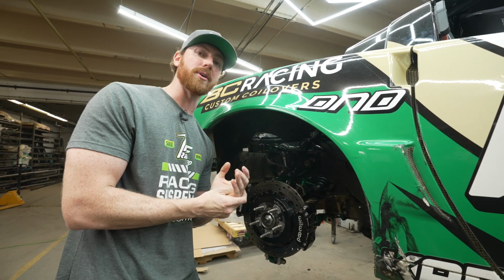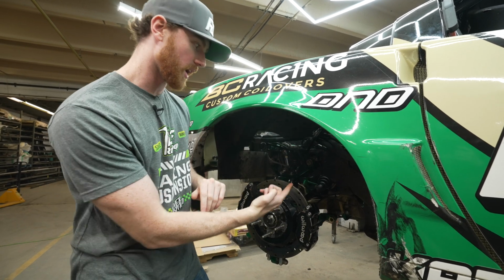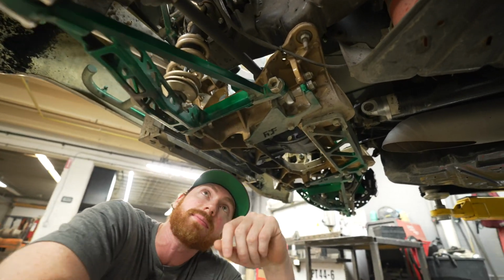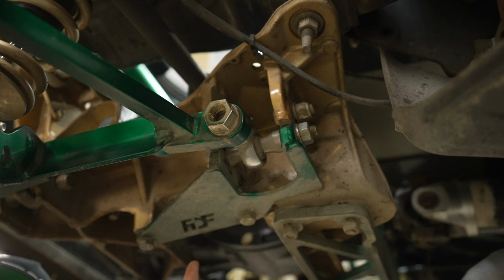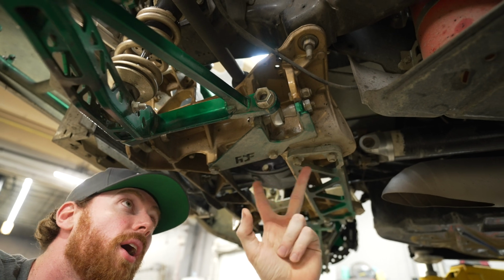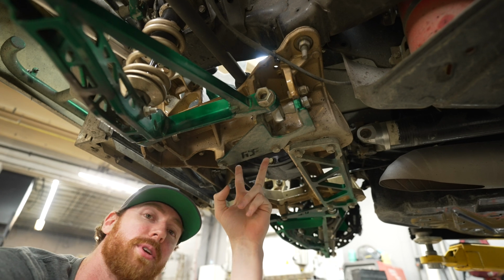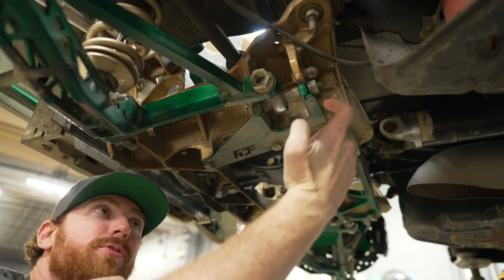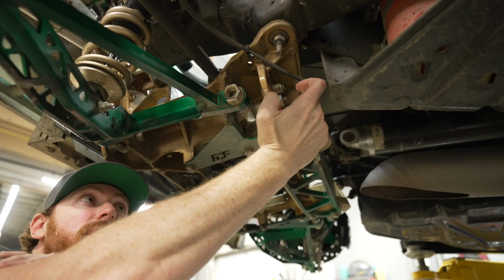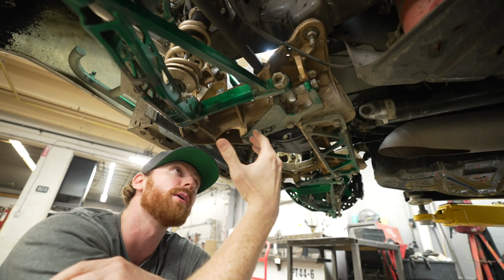So we gave you the ability to adjust anti-squat from the factory location, and then 3 more points below that. You can see that right in here on the subframe. Jack, can you see it? Here? Can you see? Yeah. Okay, Jack. Okay, guys, this is the anti-squat adjustment bracket. This bracket bolts to 2 bolts on the subframe that used to be used for the leaf spring. And then it offers 4 holes in the sides that are going to give you the original location, 1 hole below, there, and there. So with that, we are able to adjust it.